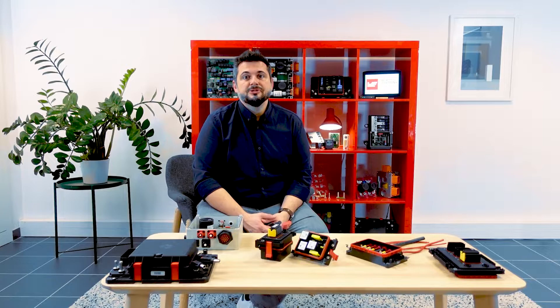As you know, 48V systems have several advantages. Voltage level below 60V simplifies the safety requirements in an electric vehicle. The components are also compact and have a limited impact on the total weight of the vehicle. All of this makes 48V a competitive solution for electrification to increase the power and reduce CO2 emissions.